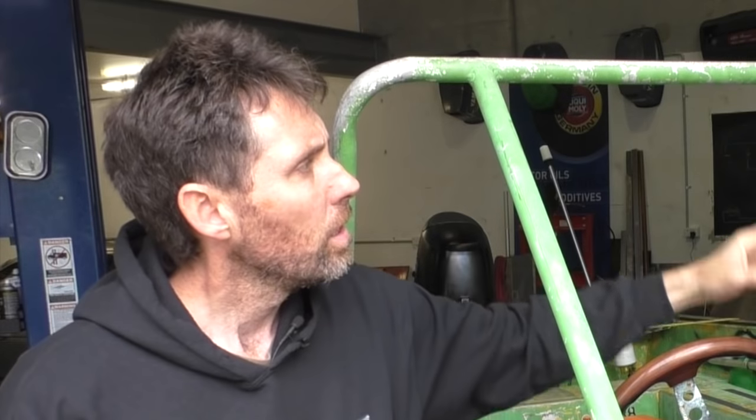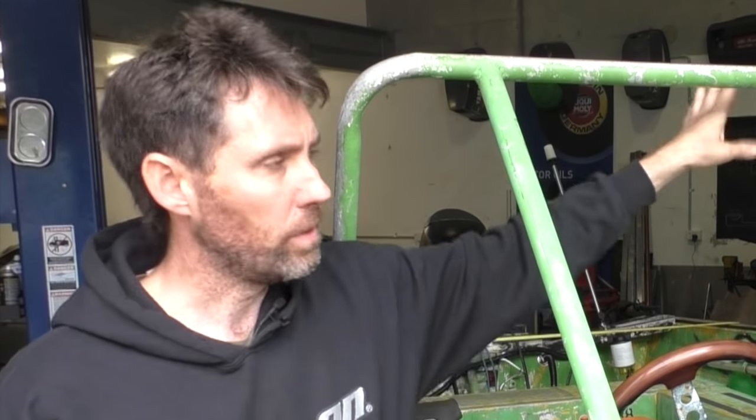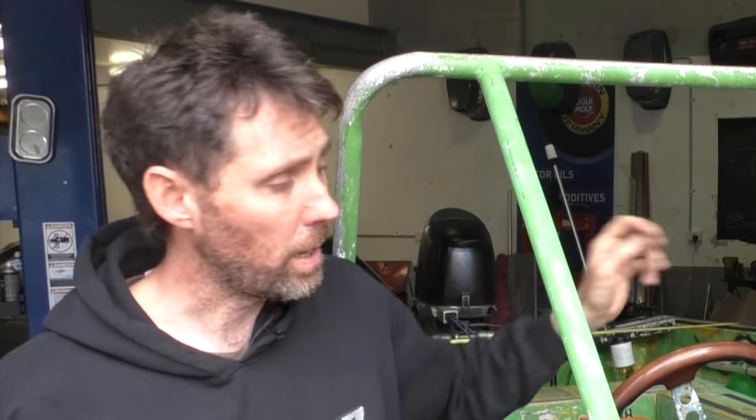My plan is to mount them up above the driver position. I was going to put them more central, but the way this boat ties up you actually have to get out of the boat over the bow. So I don't want to divide the space into two small sections. By keeping them over this side I leave the whole other side for jumping over the bar. I'm also going to try and drill through the top and run the wire inside this tube, which means getting under the dash — a bit fiddly, but much neater than cable tying it down the outside.